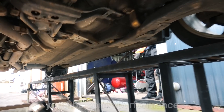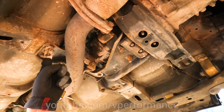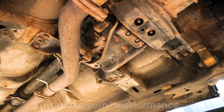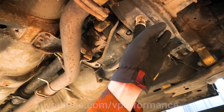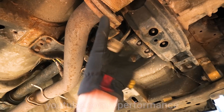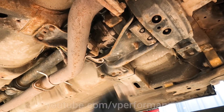The prop shaft — we don't need it out, we can let it all swing down and off. So we're removing that cross bracket thing. We'll leave the one further forward for now. And that's to get access to the transfer case — we need to get into that.